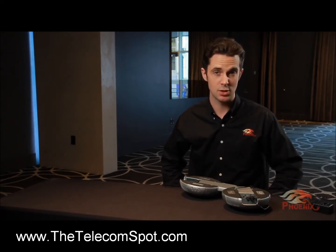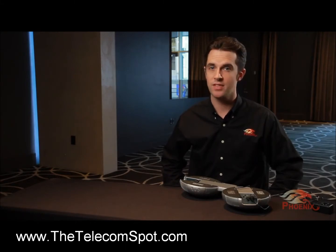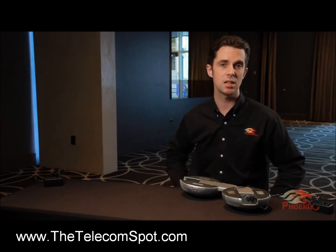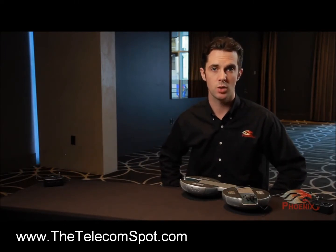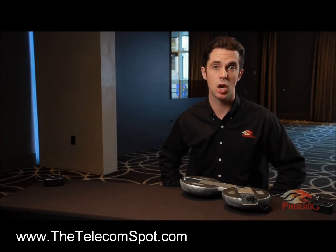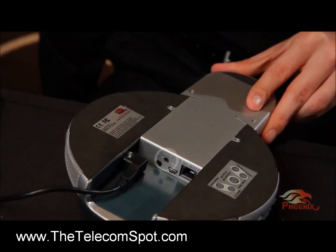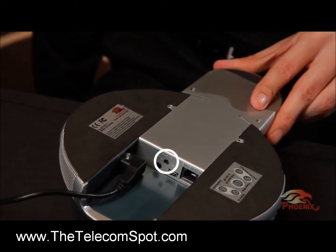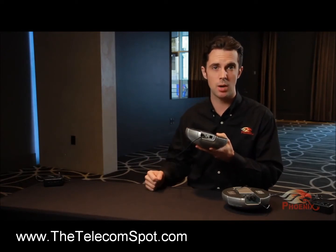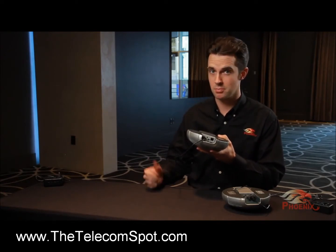How do we use the central power scheme? This option requires that you have a Phoenix Audio 48-volt power adapter. All the units participating in the chain also need to have an interface card to support it. If your Quattro has any communication interface like the telephone or smartphone, it already supports this option. If it does not, it has to have a power chain card called the 304. If you look at your Quattro connectors, you should be able to locate a small DC connector between the USB and the 3.5mm connector. If your unit does not have such a connector, it does not support the power chain option. If it does, then you're good to go.